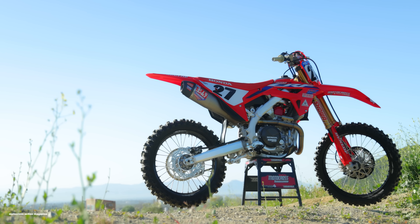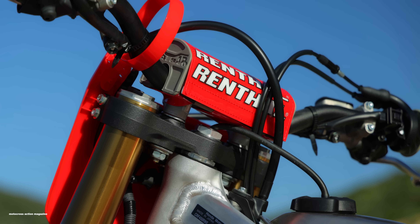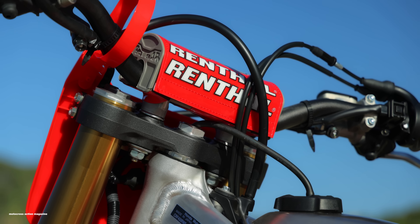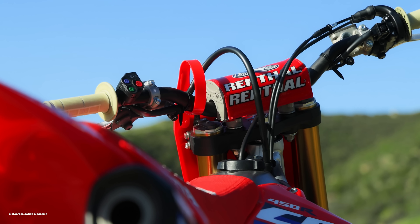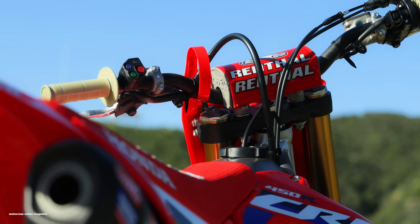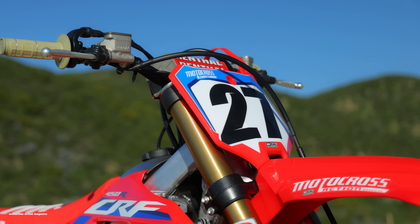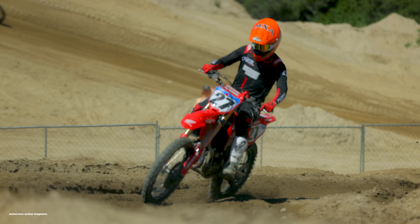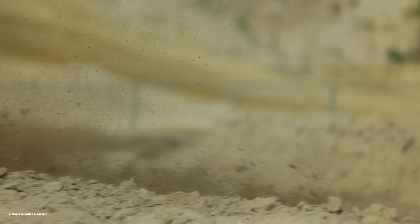Dennis, give us a rundown on what you've done to set up the 2023 stock bike and a projection of what we're going to do next on this one. The most favored item we've put on is the Ride Engineering 23.5 clamps — across the board from entry-level to the fastest guys in our group, everybody seems to love that clamp. The 22-offset triple clamps on the standard bike allow a lot of front-end movement and let the tire grab the dirt and move side to side. The Ride Engineering 23.5 clamp really allows the bike to be stable and roll into turns smoothly without all that side-to-side movement, which is a definite plus on this chassis.